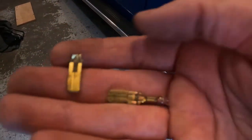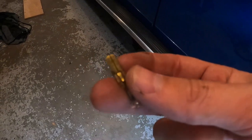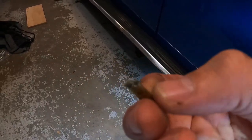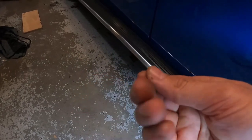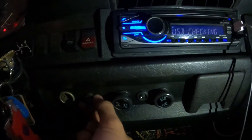This ended up taking me a couple hours to get these old wires pulled out. I pulled the wires off but they broke off of the connectors right here as you can see. These are super long, so that white box that they're up in — I was able to get this one pulled out eventually, but this one I had broken off again and ended up having to cut the box a little bit to get a better hold on it and finally pull it out. So at this point all I have to do is rewire that fan back in. Wiring it up was a lot easier than getting it unwired, but for the first time in 10 years it got some air.